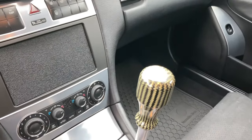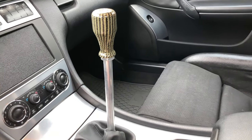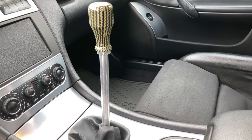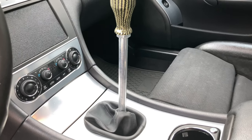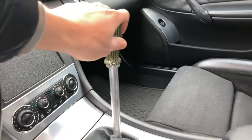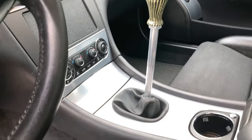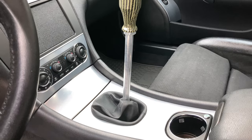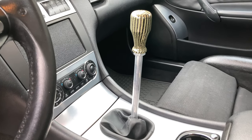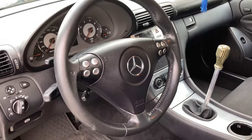The shift assembly itself I built — along with the DND shift knob, a beautiful carbon Kevlar weighted shift knob, shout out to them. The aluminum base is just 60mm aluminum stock that I cut to size, threaded the top, tapped the bottom, and threaded it onto the factory shift rod. It's very solid and feels nice. The throws aren't crazy long even with the extension — the factory Crossfire shifter is already pretty short throw, so with the extension it's still not bothersome. I'm working on a short throw for track applications.